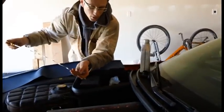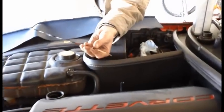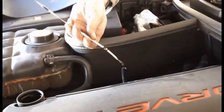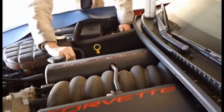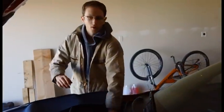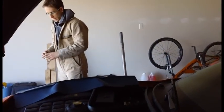Now we're up — you can see where my thumb is at the 'Add' mark. The 'Full' is right there and the 'Add' is down here. We're right in the middle, just about middle toward the top, so we're good enough to start the car. You'll probably have to add a hair more oil once we get the car leveled out, because the oil pump will pump oil into the oil filter and fill it up. I'm going to fire up the car and then look for a leak at the oil plug and the oil filter.